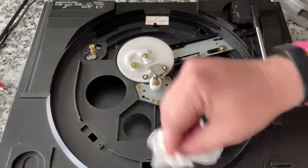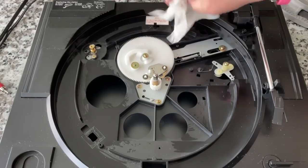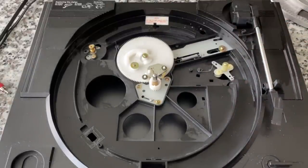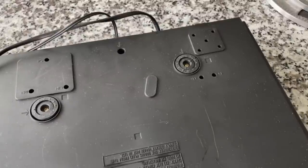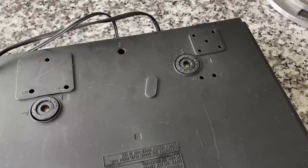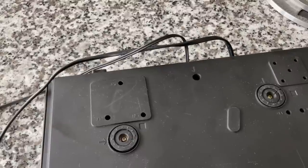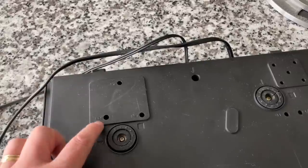We need a belt — that's the biggest thing. So I'm going to get a belt on here and a stylus on here, and we're going to be able to give it a test. This will use the same kind of JYK motor you see in suitcase players and all-in-ones. It's a DC motor — there may or may not be basic DC servo speed control in this. It is speed adjustable. If you look on the bottom side, there is a place where you can stick a tweaker tool in there — a very small one, like eyeglass-repair small. Otherwise you can short out the motor on the motor casing, which basically speeds up the motor and you can't tell what speed you're setting it at. We've also got adjustments here for setting the drop, the return, and the reject point on the automatic functionality. If it's dropping the needle too far in on the record or not far enough, or if it doesn't let you play to the end of the record, you need to adjust the return/reject point.